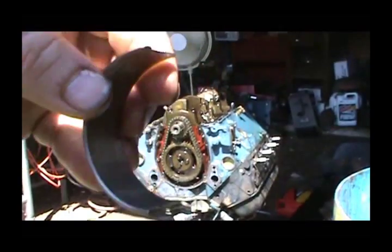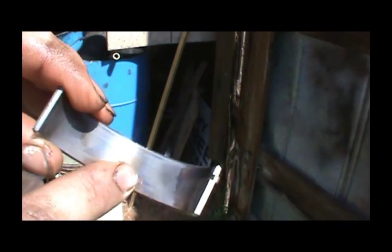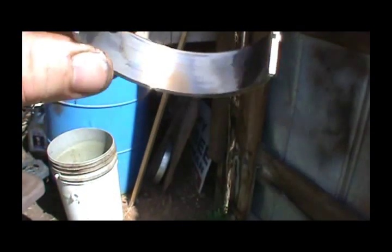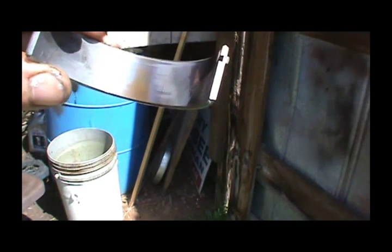Let's look at the main. Well guys, here's the main — as you can see, it's standard. It is wearing through the first coat into the second brass coat. So I'm thinking I'll go ahead and replace the main bearings just because of the way they are. That's already showing me it's got more than 20,000 miles on it, unless they were rough miles with very few oil changes. I think that'd be the best way of doing it — just go ahead and replace them now and not have to worry about it.